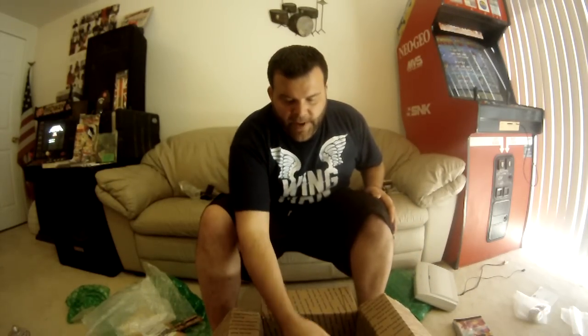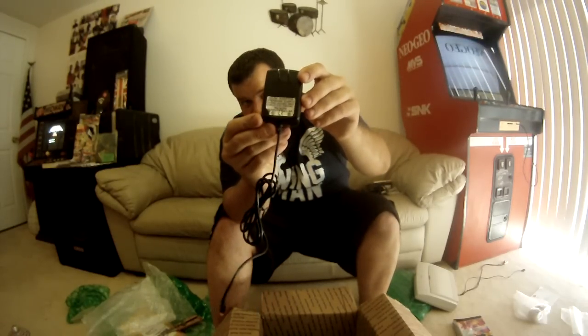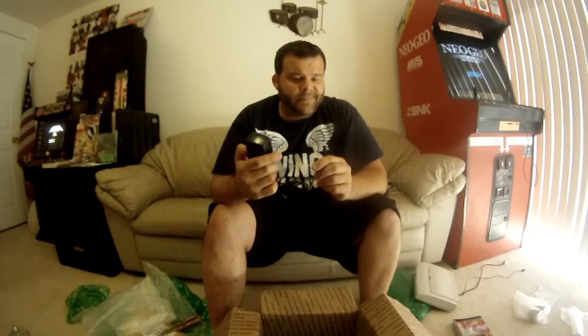These things came with these horrible power bricks, and this is an aftermarket plug. It's cheap as hell, it's light, very flimsy, but it is brand new. And it doesn't draw nearly as much power as it would have 20 years ago. It outputs precisely the voltage that you need. Yeah, it's not original. Maybe I'll try to buy an original Duo plug if I find one cheap. It doesn't bother me, and it shouldn't bother you, particularly collectors. It's just, if you play your systems, you need to have a proper power supply. Otherwise, you're just going to kill the damn thing.